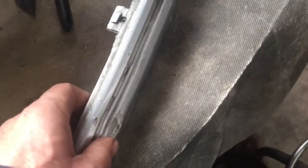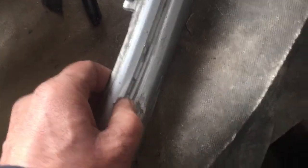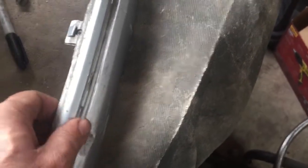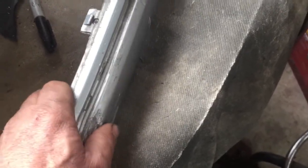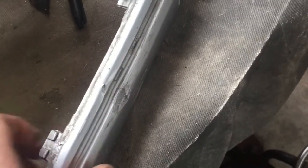The other part I'm working on is this trim piece that goes around the bumper. It's a broken bumper piece and you can tell where it's missing. I'm heating this up to see if I can press this dent out, and that way I just have to get the chrome trim strip that snaps into it. I'm going to try to press that out — it's got a big deviation in it. I might have to do a little bit of filler. We've got that special filler for rubber and plastic bumpers.